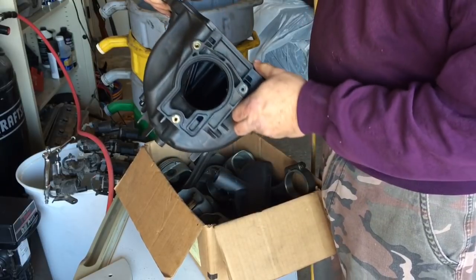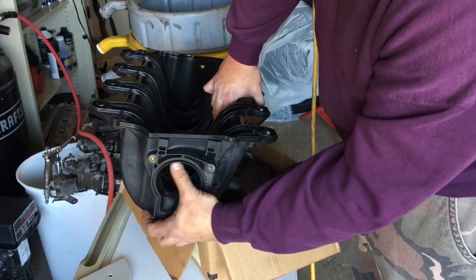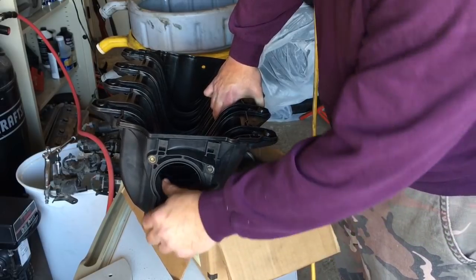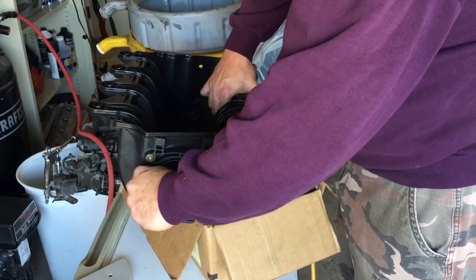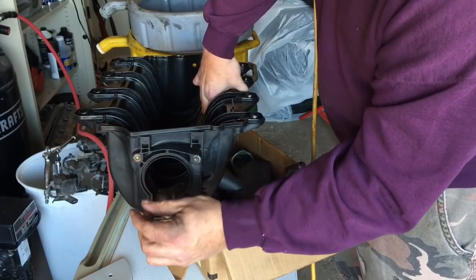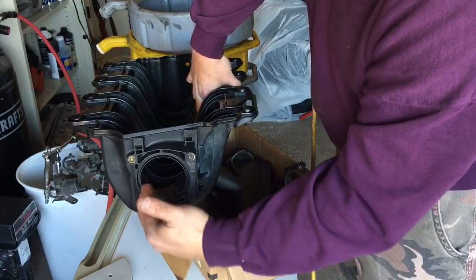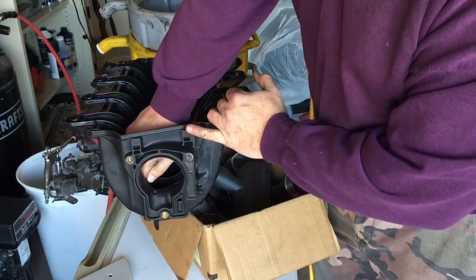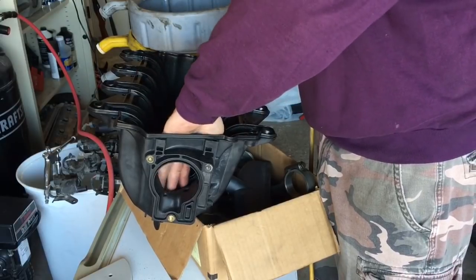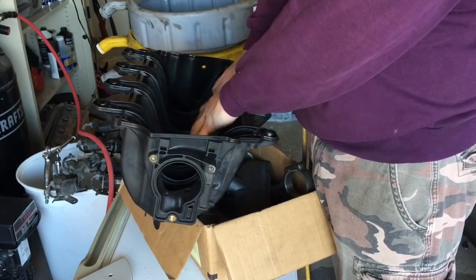I haven't mic'd this particular intake, but I was looking at it last night. You can't open it up a whole lot from where you're at, because you still got to be able to seal your rubber gasket here. But there are huge overhangs — literally on this side of this port, I bet close to three-eighths of an inch or more will be removed. See how this opening is this size and then it necks down right here — all that material can be removed and not affect anything with your inner structure. You're just making the opening larger so that you can flow more air into the common plenum.